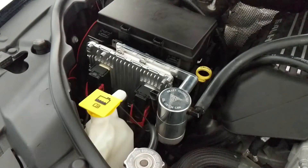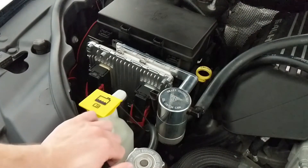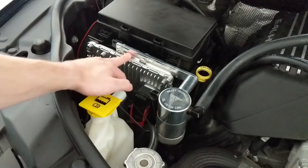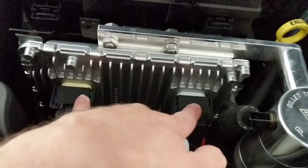Here's a video of the actual installation of the PCM. I already did the actual installation, so it took a little bit of time to maneuver everything. I think it would be a pretty sloppy video so I'm going to give you guys a shortcut. You're going to need an 8mm socket — there are three screws securing this PCM to your vehicle. Before those screws though, you're going to want to remove these two electrical connections.